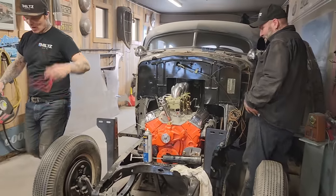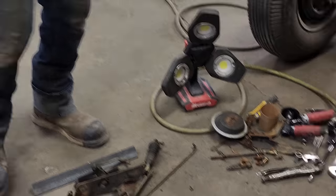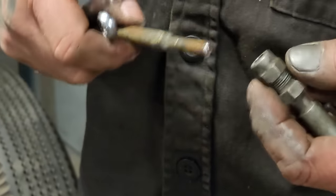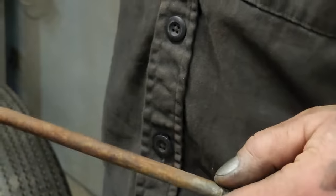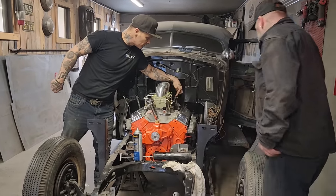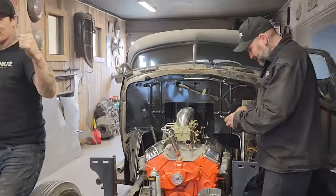I looked at it yesterday and I was thinking, wow, from all that stuff there, to make that. Also, what Nathan was talking about is these little shafts here. This one come off? Yeah, that one there should come off. This is on older Jaguar stuff. It comes apart, and it's got just a friction fitting, I guess you'd call it. You slide it on and then tighten it up. Adjust it back and forth. So that one on the carburetor is adjustable. We can set that up and down, and we'll set the pedal up and down the same way, right? This piece here slid on, it's got a bolt system that can be adjusted. And I think even the other one can be adjusted, down there on the pedal a little bit, yeah. Excellent.